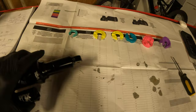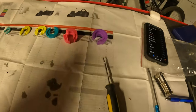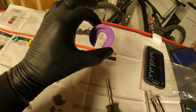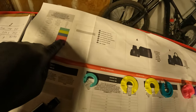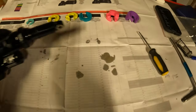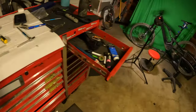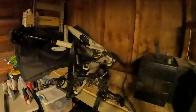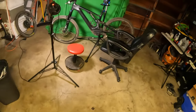Let's talk about what volume spacer you should put in your bike. The Levo 210 by 55 can take any one of these spacers. I am 220 pounds — I would personally run the biggest one. If you were 220 pounds I'd recommend that one. 200 pounds, put the orange one inside of it; maybe if you're 190 and then accordingly down. Depends on riding style. If you have a heavy e-bike you're going to need more volume reduction, and if you have an acoustic bike you're going to need less. If you're a heavy rider like me, you're going to need more too — heavy rider and e-bike means a ton of volume reduction.